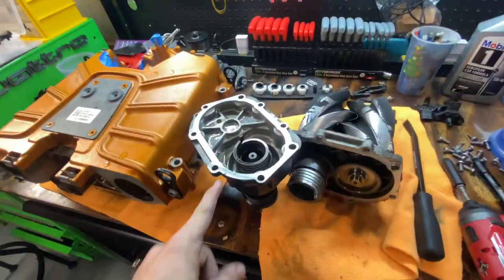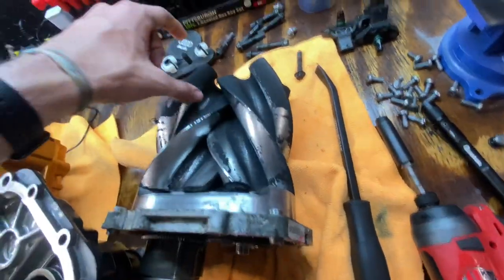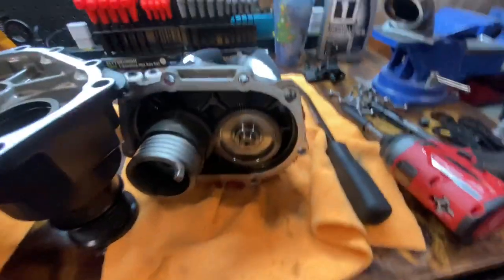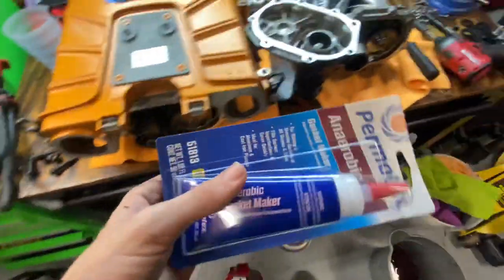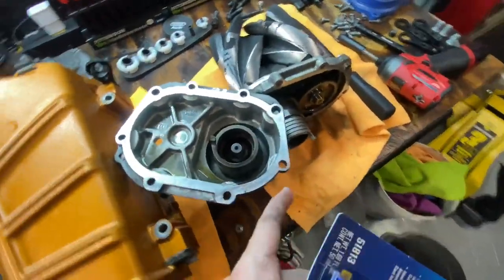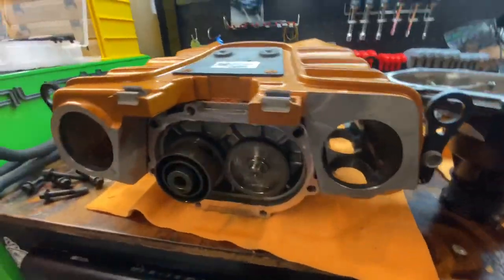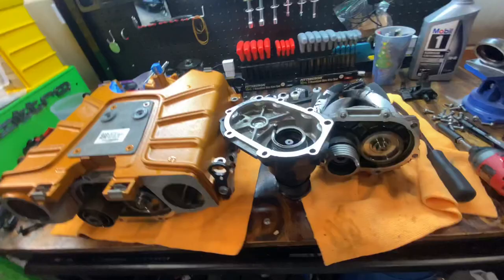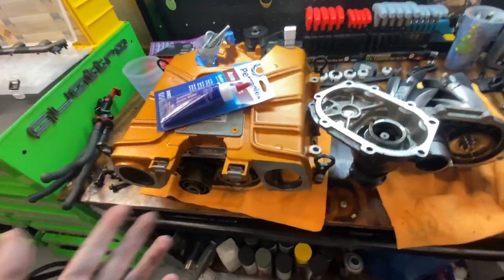As you saw in the time lapse, I popped the snout off the red one and pulled the rotor pack out with it. A little bit of methanol has been ran through there. All the gears still look good, teeth are all intact. Very important here — this is called anaerobic gasket maker. You have to lay a nice bead of this all the way around. Make sure the surface is clean. Good news is Shane literally just put this snout back on this blower, so it had fresh gasket maker on it and it wasn't hard to come off. This one popped right off.